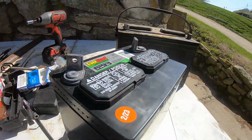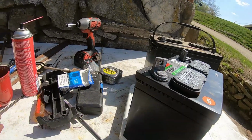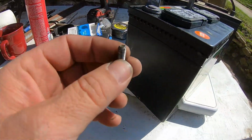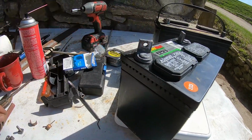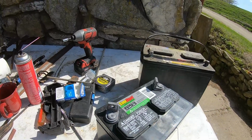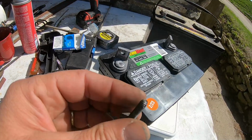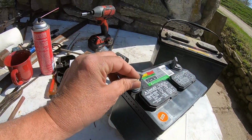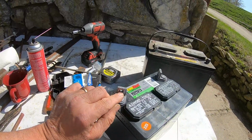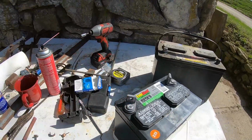Let me get one thing straight here. The way I attach it is I use these little holes here in the side. Since this is metric, it uses these little teeny battery clamp bolts, so they fit in the hole all right. But if you're using a regular, bigger USA clamp, the bolt size is probably more like 1/4, and to get that to comfortably go under there, you may have to take a drill, usually a 5/16 drill bit, and drill that out. It drills right through it. It's made out of lead. It's really easy to drill.